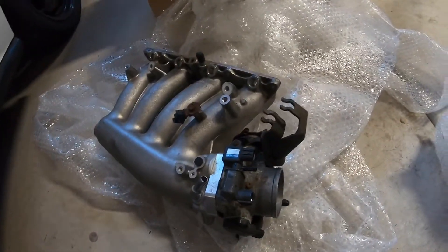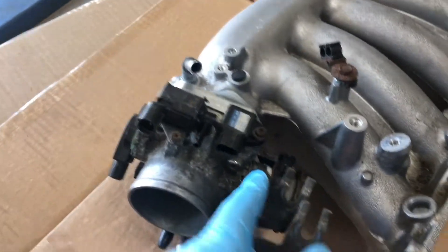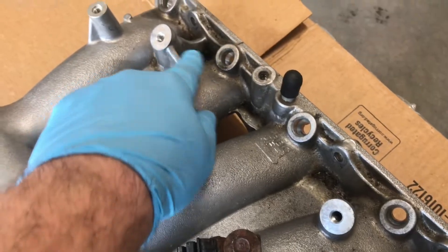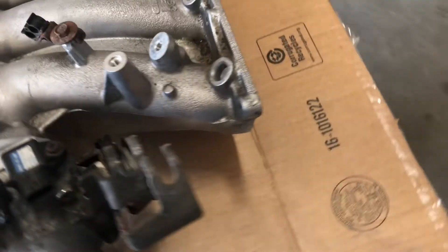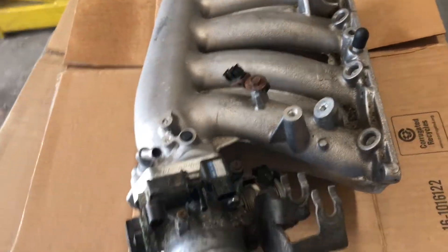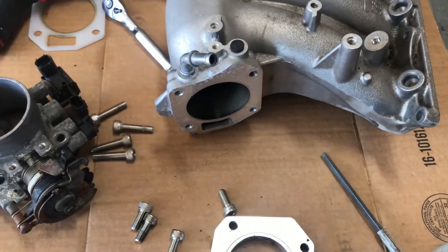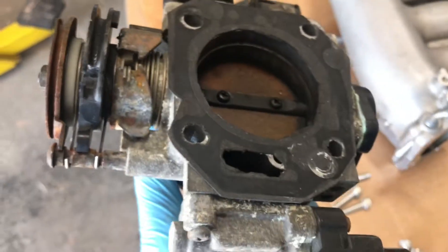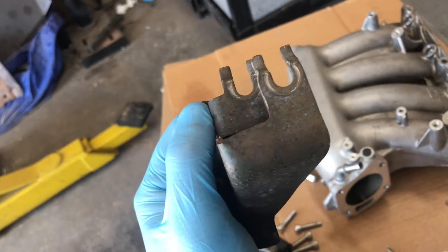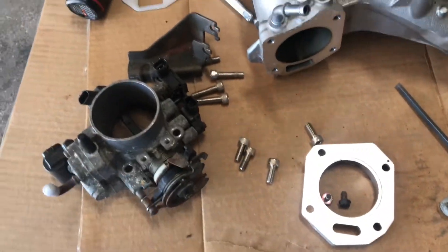So I'm gonna pick up from here and work on this thing. Here's the RBC prior to cleaning — a lot of corrosion on the throttle body. This came from the East Coast so it's pretty common. This hose I have no idea where it goes but it's coming off. All this goop is gonna get cleaned so I can prep it for paint. I'm not really sure what the sensor does, but I'm gonna take everything apart. The K-Tuned bracket hardware was all loose — I don't know who put this together. The throttle body looks terrible, so I'm probably gonna take a wire brush and wire wheel to it to get it as clean as possible.